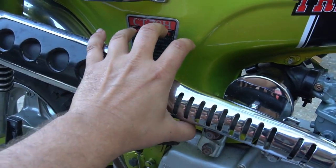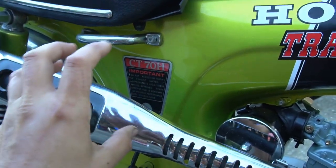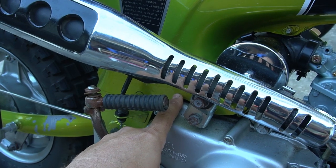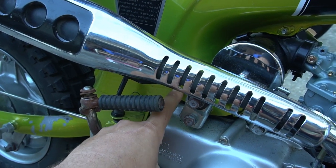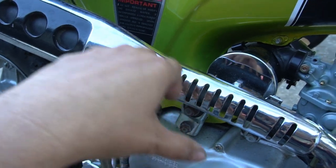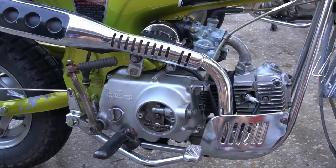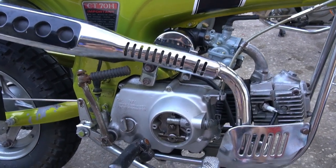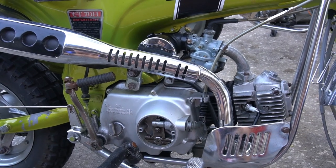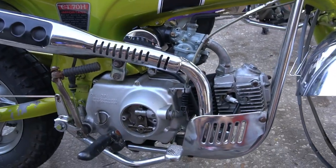When I pull this engine, we're going to put the sub harness in to interface from the Lifan 12-volt engine to the existing OEM harness. The coil is a 6-volt high-tension coil on the original bike, so we'll use the coil that comes with the 12-volt Lifan engine and swap that out while we have the engine dropped. The approach I'm using is not altering the bike drastically — just plug-and-play changes. We're leaving the original harness in place.